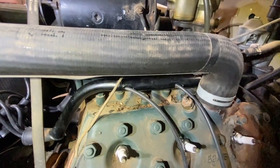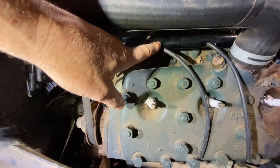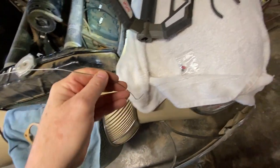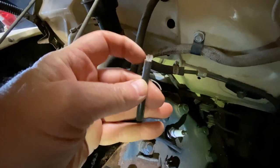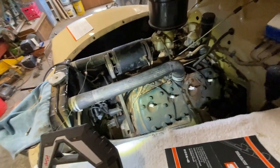There's a little slot in the middle where the wire comes out. Check your distributor cap and it'll tell you which wire goes to which plug. As it reaches there, just pull it out with a pair of needle nose pliers. Now the last wire that comes out the very end is the hardest one to get through. What I did was use a small thin gauge wire, fished it through, and cut a little hole in the very end of the spark plug wire with a small Phillips screwdriver. I punched a little hole through the end, fished that wire through it, bent it around, and just pulled it through. If you put some lubrication on the outside of the spark plug wires, they will slide through easily. If you don't, it is a challenge and you will wrestle with it.